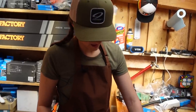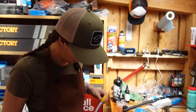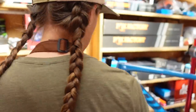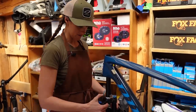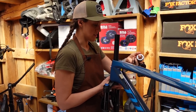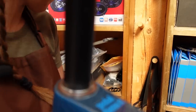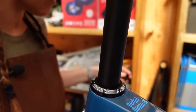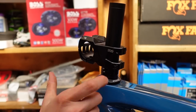Did not have an organized workspace today. This is the part where you can really mess up. So we're going to put the headset bearing down there. I don't really need grease because we're just measuring. This is the part where you determine the height of your steer tube and how much you need to cut off, which depends a little bit on personal preference. Let's put the other spacer on there — I don't mind having a little bit above.